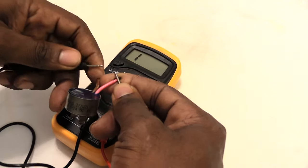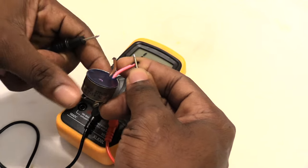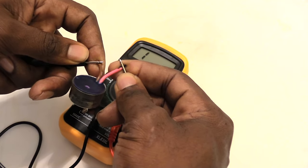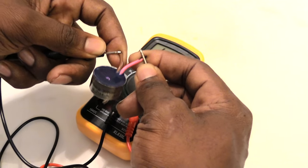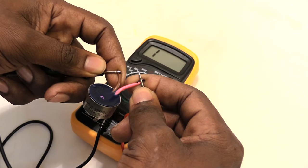I'm testing it again and you see nothing. So to test these when it's warm, you should get nothing — no sound or anything — which tells you the circuit inside this thermostat is open. You shouldn't get anything when it's at room temperature.